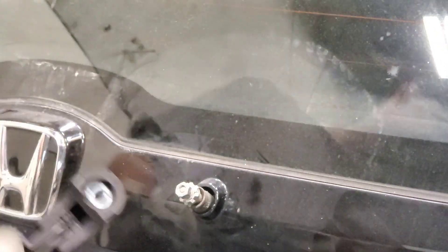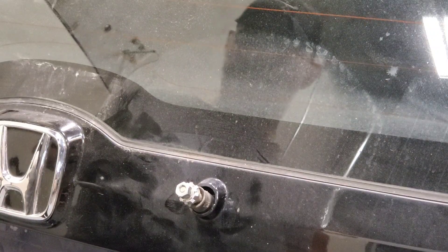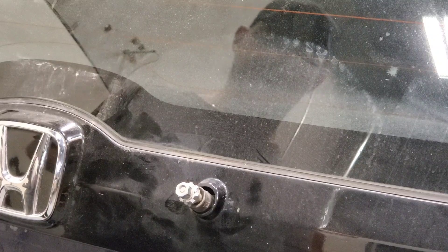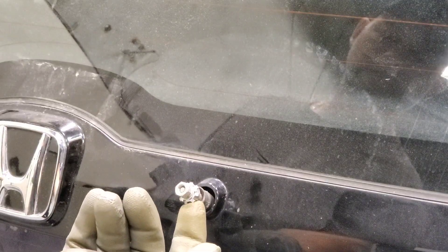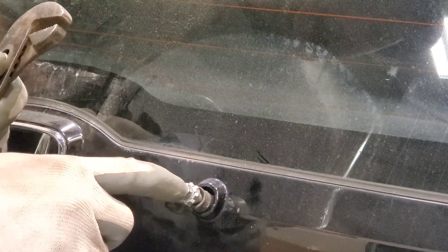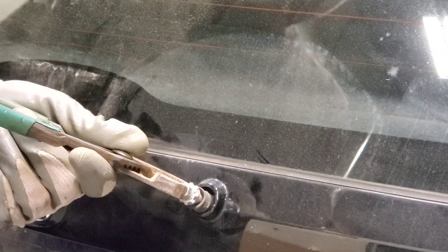You can see the gears on the old part. The new part I bought is smooth on the inside. I did look into this and other places carry the same part with the same issue. So I'm going to loosen this off — it's 10mm. I'll take my channel locks and see if I can pull this part off. For the nut, make sure you back it out enough where the stud is flush or the nut is slightly higher — you don't want to mangle the end of the stud.